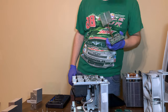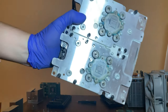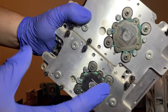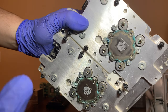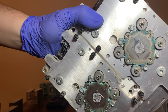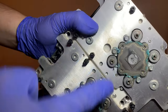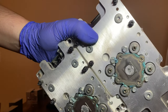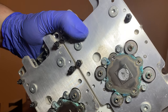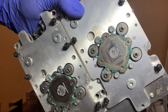So yeah, I forgot to show you guys the pump. This is the number one place where they leak, is around the O-rings, which goes in here. Dexcool eats through the rubber O-rings, and it just kills the O-rings, and they leak everywhere, and then the system's dead. And this crystallization is from the heat and the air-oxygen mixture all reacting and causing this to happen. Because I've read that Dexcool is supposed to neutralize itself when it hits air.